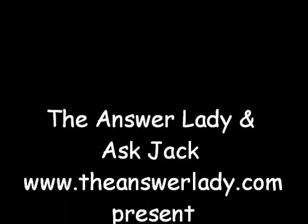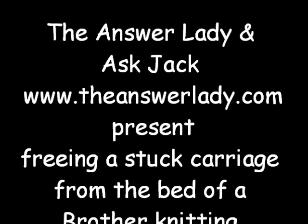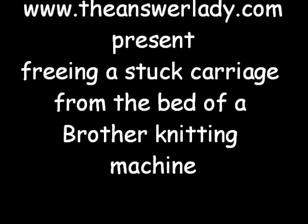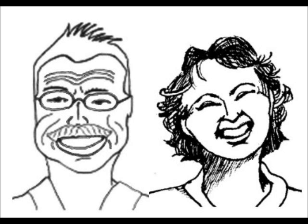Most of the time, if a Brother carriage gets stuck on the machine for some reason, we just turn it to CR. That releases the carriage from the bed and we lift it off and solve the problem, whatever it might be. Every now and then one sticks and won't go into CR and won't come off the bed. And this causes consternation and we don't know what to do. What if CR doesn't work? Jack is going to help us figure that out.